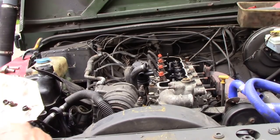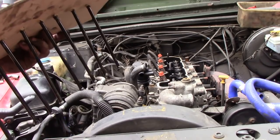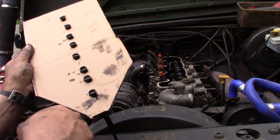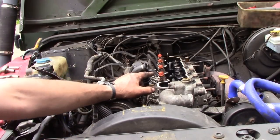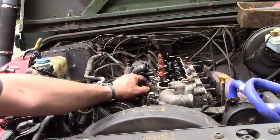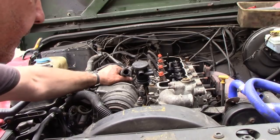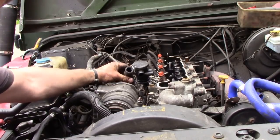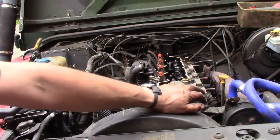We're just about ready to take the head bolts off this cylinder head. I've put the push rods through a piece of cardboard with a little arrow pointing to the front, and caps are on the injectors and on the injector pump. What did I notice? This pipe here is full of gunge — I don't like that; I don't know where that's come from.